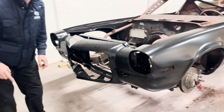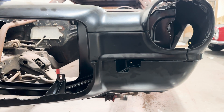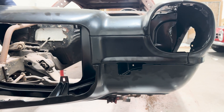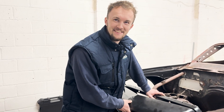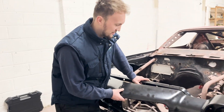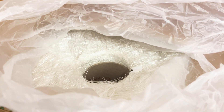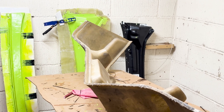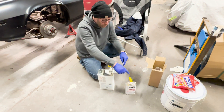So this doesn't fit. The lower bumper is an RS or a Z28 and the upper bumper is a standard Camaro with no options. The lower mould came with the car, so there's a bit of a gamble making a bumper out of it, but we're learning. With the lower valance mismatched to the upper, the team catches a lucky break — the Camaro came with a mould for a lower bumper. Their goal is to fabricate the part in carbon fibre, not just to practice their techniques, but to check if it fits and avoid the hassle of modifying or importing another one.